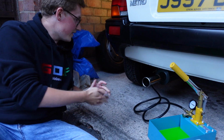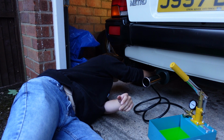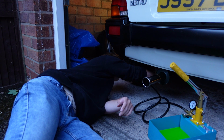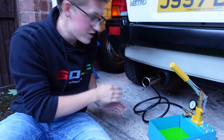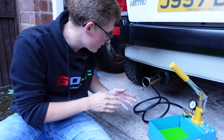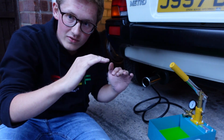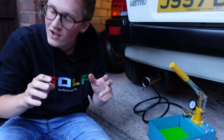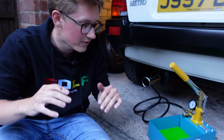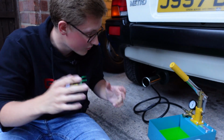So now we can get back into the suspension by turning this T-bar. And there we go. We are now in, and the pressure reading is showing just over 300 psi. So it's a bit higher than that side, but the car was just ever so slightly lopsided. You couldn't really tell unless it was on a perfectly flat surface and you looked at it from a certain angle quite low down, but it was slightly cockeyed.